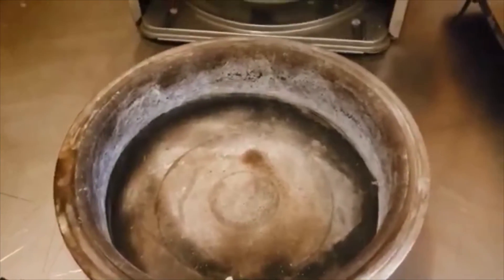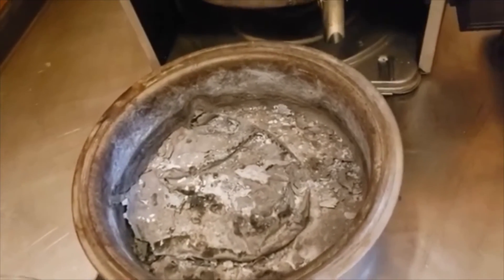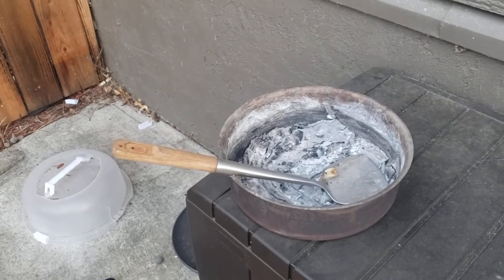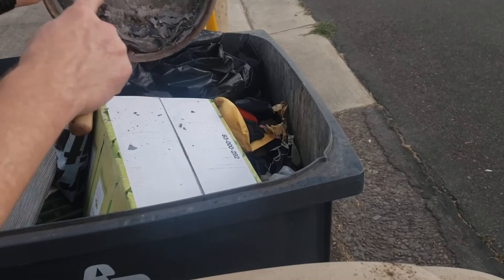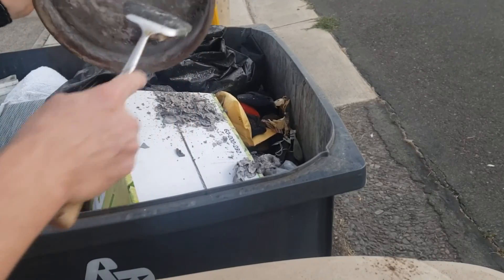To empty the chamber, use the lever to drop the pan and remove the contents by lifting out the inner bowl. You can replace the contents with the new bowl. Once it's all cooled down, use the metal spatula to scrape the contents into the garbage can. You can scrape directly into the garbage, or scrape into the inside garbage can and then transfer the contents.